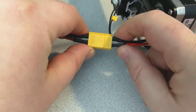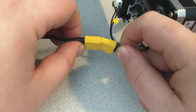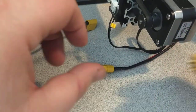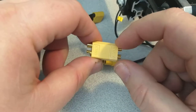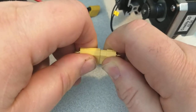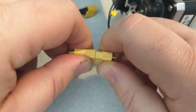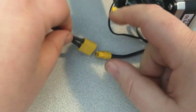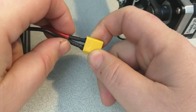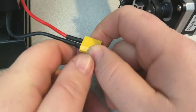If you take a look at this XT60 connector that's on here, this comes apart really easy. Whereas a real XT60 connector — they are much, much harder to pull apart and put together. The other problem that people are having with these, that only a handful of people actually seem to have reported, is that these ends are crimped rather than soldered.